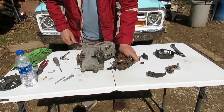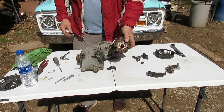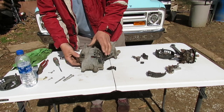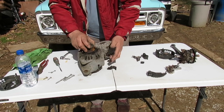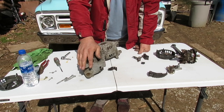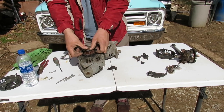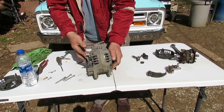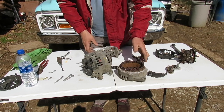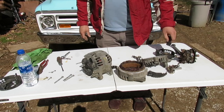Be careful because this one was already messed up - I couldn't get the nut off and had to grind it, which may have contributed to deforming while I was beating on it. Just be very careful driving the whole thing out. It would be even better if you had a wheel puller - just pull it out with that.